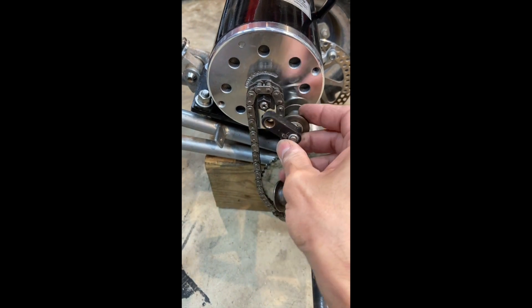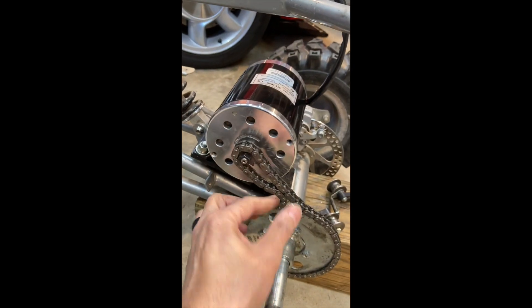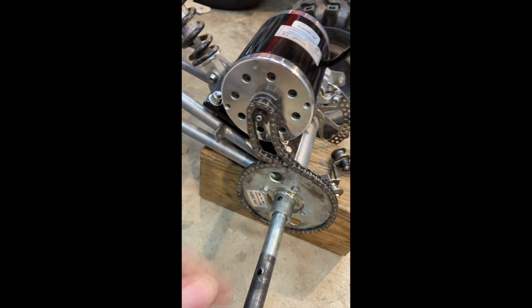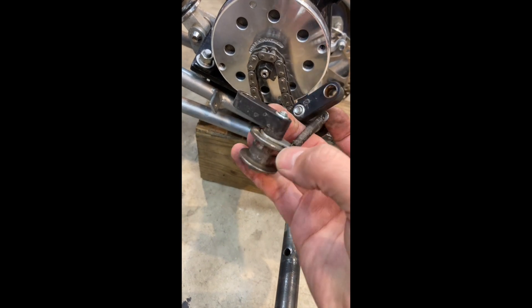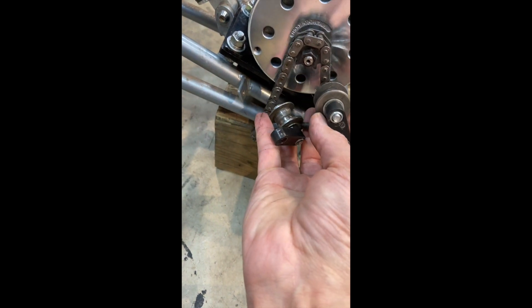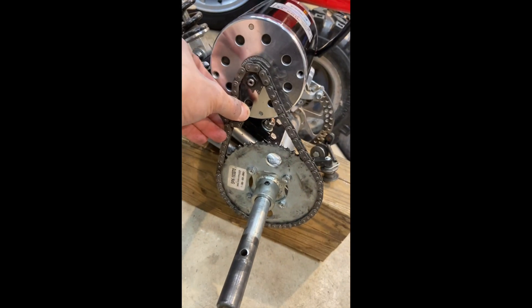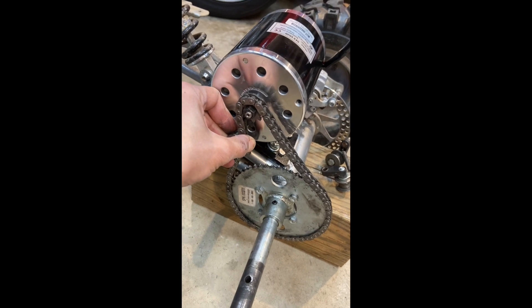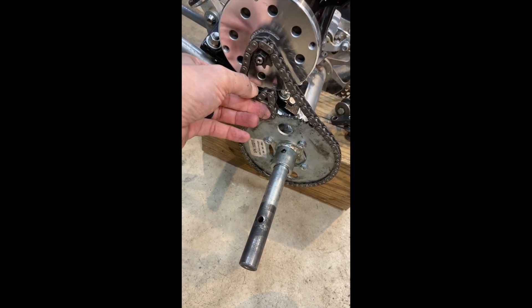Given that this motor is a direct drive with such a small pinion sprocket, in order to get the right torque and speed I need, I have to run a really small sprocket up top. There's just not much chain play for the tensioner to take up - it would be super tight. My only option is to try it without the chain tensioner and run it direct. With an 8 millimeter tooth we've got enough depth to prevent chain jumping, but I'll need to modify the chain length and run it direct.